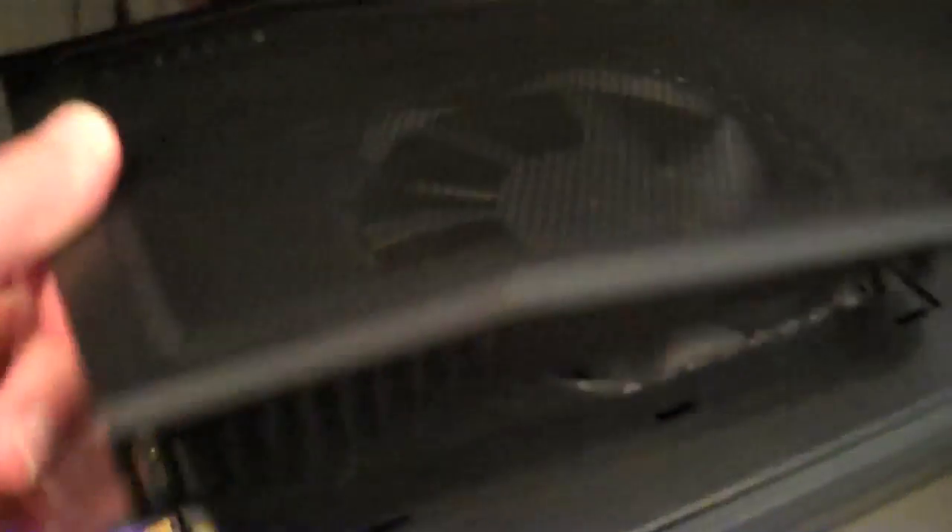Here are two quick examples of integrated fan grill removal on an Antec P180 case. As you can see, I'm using some rubber sound-dampening material between the fan and the case to get as quiet as possible, but the majority of noise reduction actually came from the removal of the steel grill. I also did the same thing on top of the P180. Well, that's about it for this week's episode of PQA. If you have any tech questions, send them to questions@PetrasTech.com or twitter.com/ptpetra. See you guys next week!